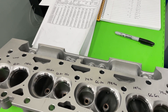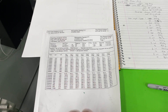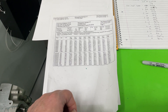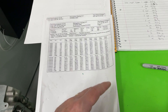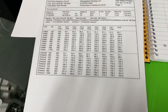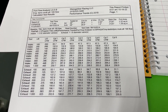This isn't my first time flowing all eight cylinders on a head — I did it before on the AFR 305 big block Chevy head, which you can watch a video about. That head was cast in America by Edelbrock. AFR doesn't have a foundry — only Brodix and Profiler have their own foundries that I know of — so AFR used Edelbrock's California foundry for that casting. The big question for this video: was the Chinese casting that far different? Here are all eight cylinders — I'll hold this so you can pause your screen and look at how different they are.